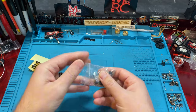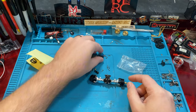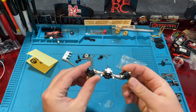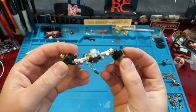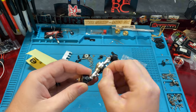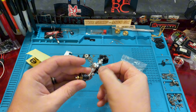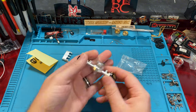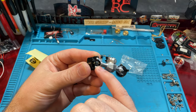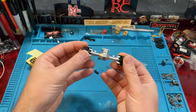These are Plus 5 millimeter, and they claim to have up to 52 degrees of turn radius. I mean, that's pretty nuts — with no binding. Nice and buttery smooth. Pretty wild. So I'm going to show you what these are about, show you why they get such good turn radius. It's this little double-jointed deal. That's why it's called an isokinetic three-section CVD.